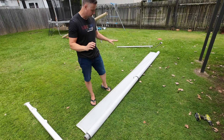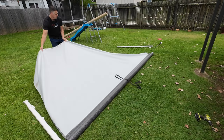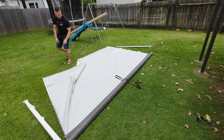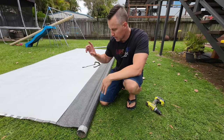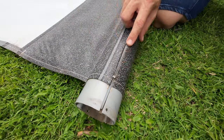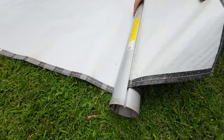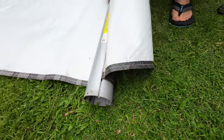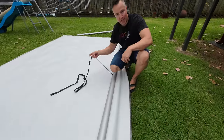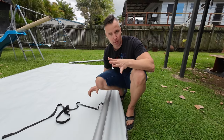With the two arms disconnected, we need to unroll the existing awning skin. Once unrolled, you'll see on either end of the awning there's a stainless steel screw — there's a plastic spline running along there that holds the awning skin to the tube. I'm leaving the pull rope in as a reference to know which spline orientation to use for the actual skin.